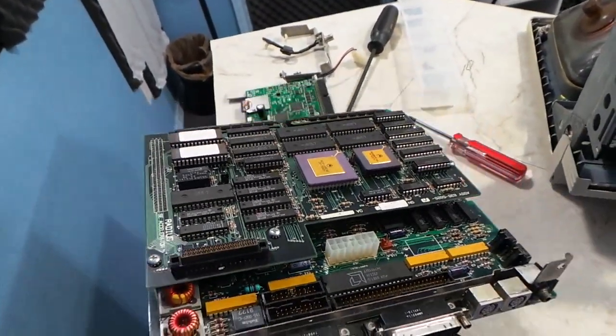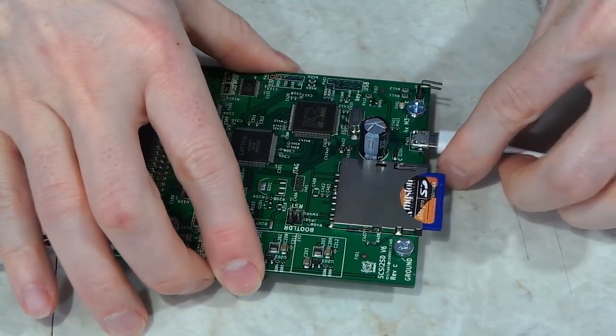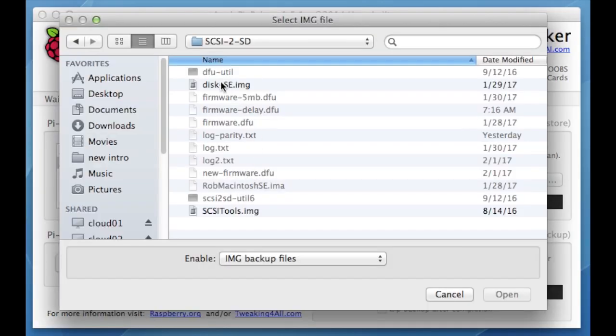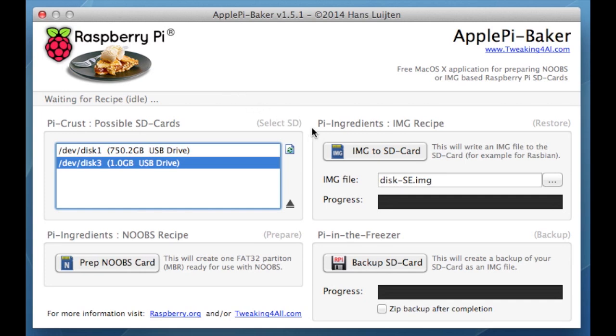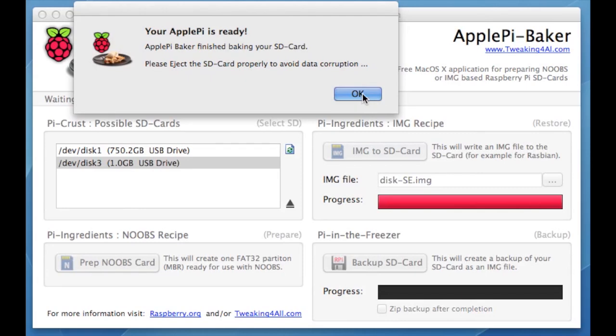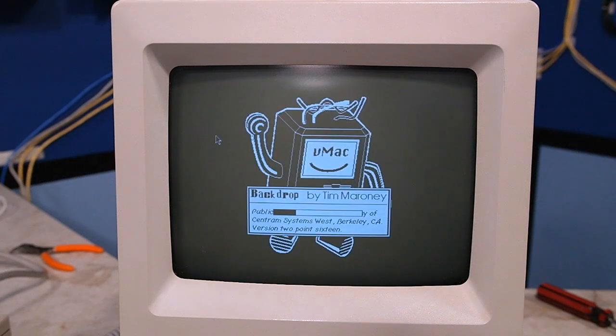Keep in mind these units aren't entirely identical — his Mac has an accelerator card on the logic board, which changes things quite a bit. In one last ditch effort, I used Apple Pi Baker to copy a working hard drive image that somebody sent me from another Macintosh SE, to see if I could get it to boot directly from the SD card without installing the OS. To my amazement it did actually boot part of the way up, but it would always lock up at some point during the boot process. It does prove that the card is at least somewhat operational with the computer.